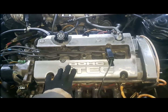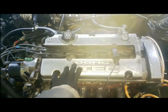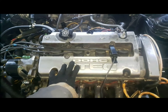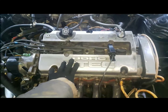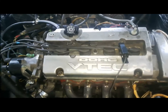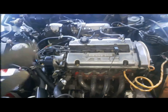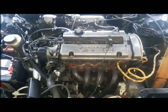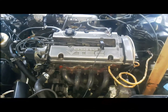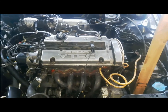Hope this helps — this is a huge success. That knocking sound was so loud it sounded like a connecting rod was broken, but that's not the case. It's the detonation knock sensor. The detonation timing had to be right. Amazing difference — the knocking comes and right away the computer corrects it. Please share and subscribe.